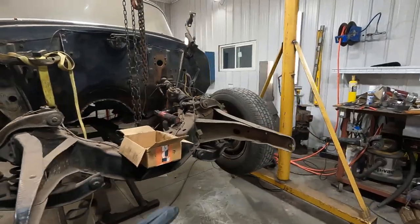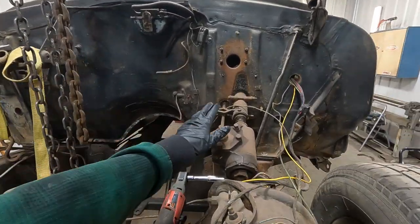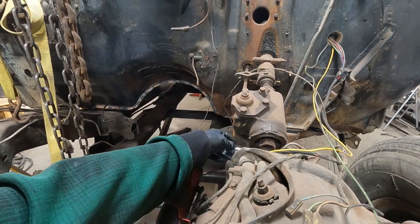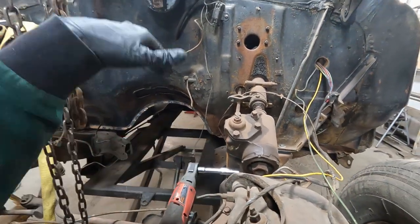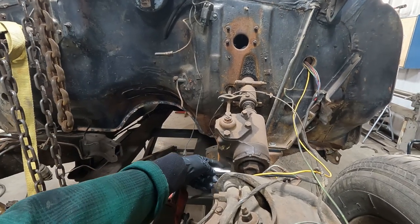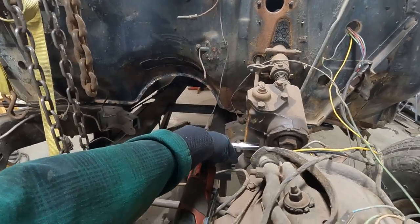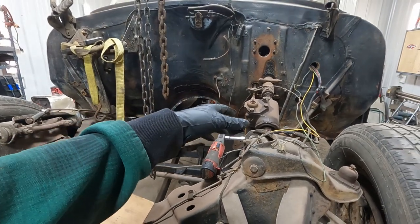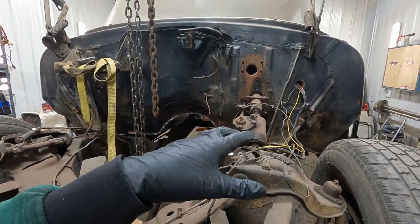The one thing that's unconventional is I'm not removing the steering column at this point. I'm just going to take the steering box off the frame. I've already had this off when I put the floor in because I tilted the whole car up and slid the floor in. So I'm going to undo the steering box from the frame, remove that steering knuckle from the steering box, and spin that out of the way so it won't be connected.